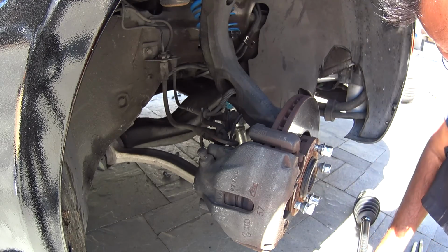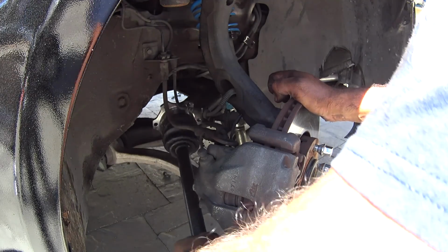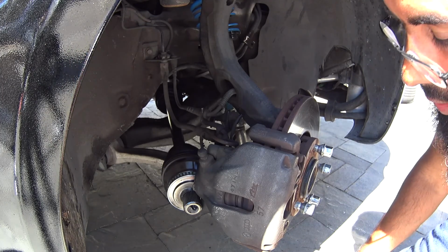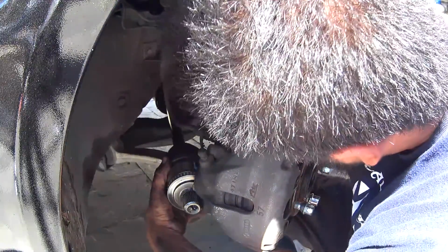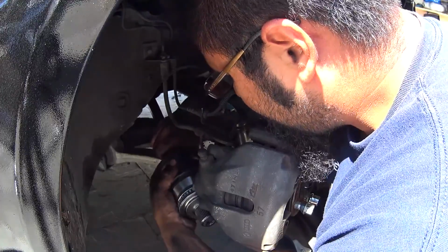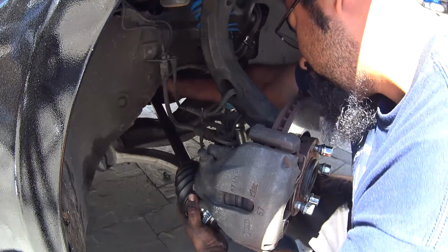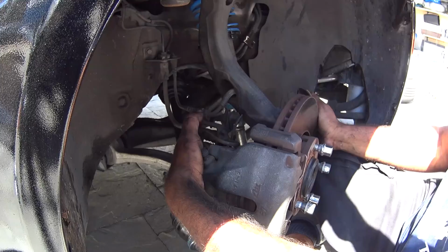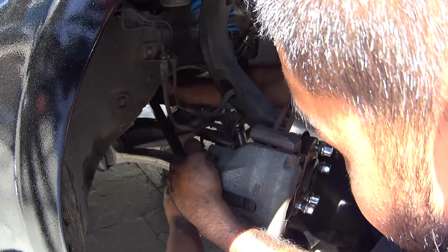So I'm just taking off the zip tie that's on here. Like we did before, you're gonna cram the axle in, and then we're gonna try to get the axle to sit as far away as we can. So you got to insert it into the cup and see if you can bend this axle in, and then twist the cup over. You want to see if you can get that in there. It might be helpful if you guys have two people. Get this up here. Got it?